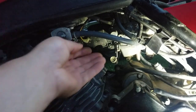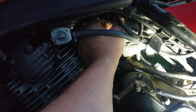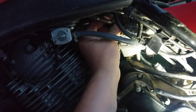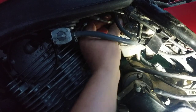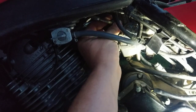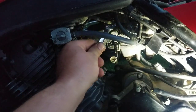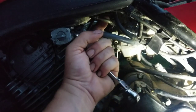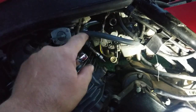You want to make sure you remove the choke cable while it's still on the bike. Remember, these are snug — they're not super tight, they're only plastic. Make sure you remove that before you go tugging on anything, because I can't tell you how many of these are broken. I've gotten wise: just take it off prior. There it is — push that right off to the side.